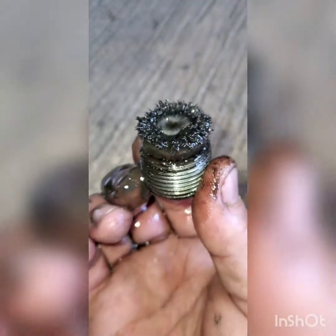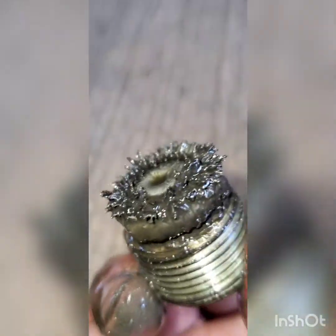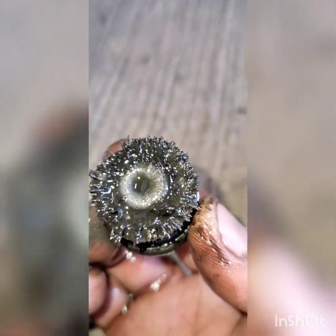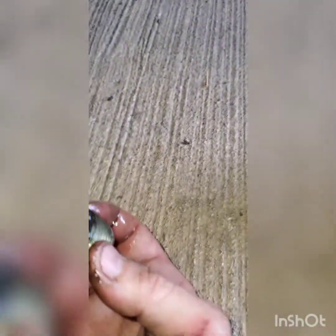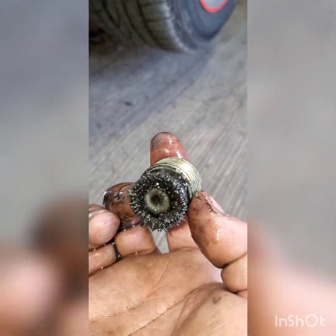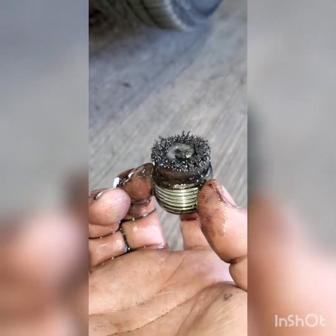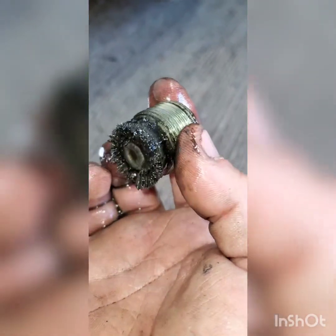Let's see what we got on the bottom of the drain plug — a little bit of metal. It's not the best, but I've seen worse. If you've seen the differential on my other 300ZX that I opened up last week and replaced, that was a lot worse and it was still driving. Let's just hope with some new fluid we don't get a scratchy third — but it looks like third gear right there, I'd say.